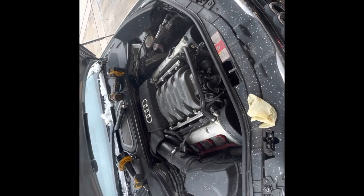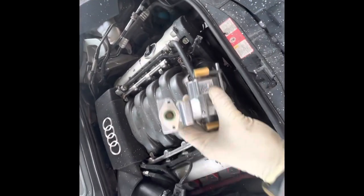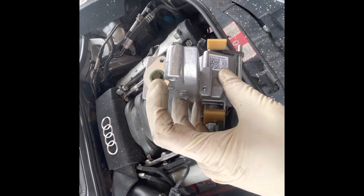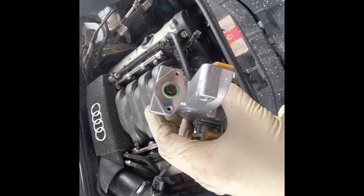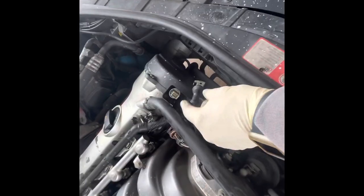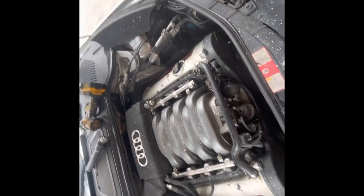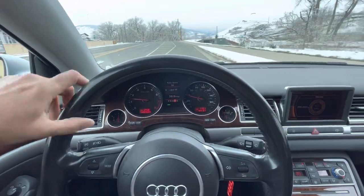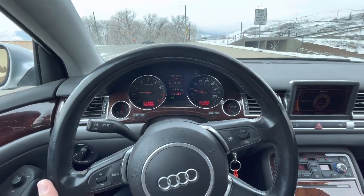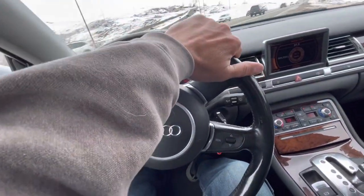I got the solenoid put back in. It's almost May and it snowed four inches last night. Word of caution — this little green seal: when I pulled the other one out it actually stayed on the solenoid, so I had to pull it back out and make sure that seal seated properly, otherwise it would have been leaking oil. I plugged it back in, snapped the connector on, and put all the covers back on. Out on a test drive now — I cleared the codes, the check engine light has stayed off, it's actually running a lot better. I think we fixed this one, pulling on the highway at 93. Thanks for watching.